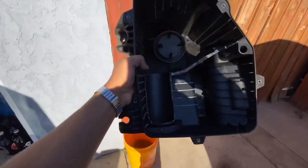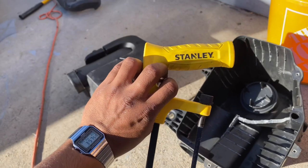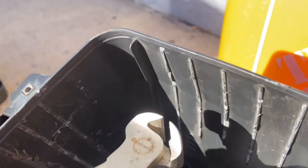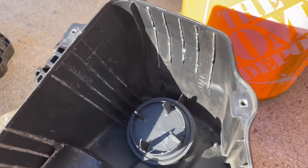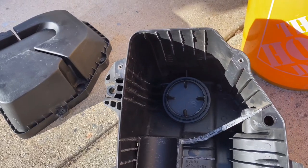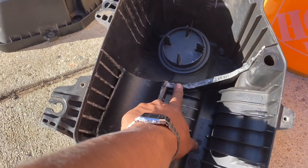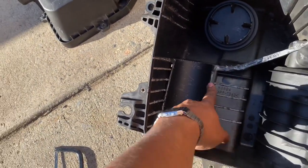And we are all done. What I used was this Stanley handsaw — it's a small one, got it from Home Depot for a couple bucks — and also these cutters, which worked really great for getting the side ribs. I used some diagonal cutters for more flush pieces on the sides. All in all you're not going to be able to cut the wall down all the way because once you get to about a half inch or an inch up it starts actually separating, so I had to fill that in with some silicone. It's all dry now.